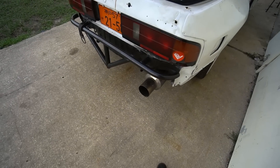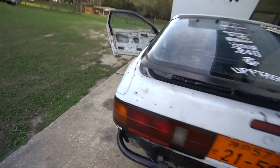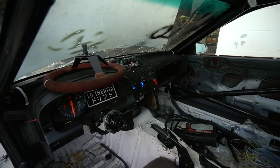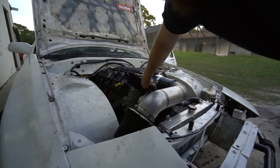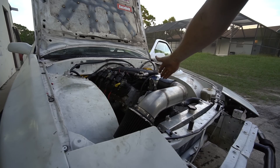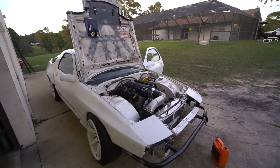Listen how quiet this thing is — it's really not loud at all, you mostly hear the engine intake noise, sounds very trucky. Right out of the gate: 40 PSI of oil pressure, that's solid. It's idling good, still a little rich, I need to adjust the tune file. But I can rev it now and it comes back to idle — it's actually running pretty good.